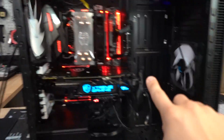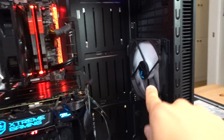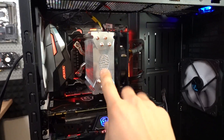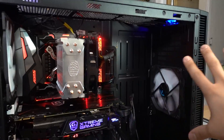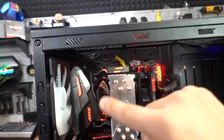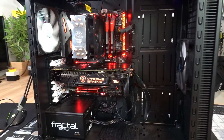The airflow in the case is probably fine — we've got a 140mm fan at the front and a 140 at the rear, but no fans at the top. If we go with an AIO, I'll probably mount the radiator to the front — that'll give us two or three fans there. Maybe we can relocate this fan to the top, or go with some RGB fans if I have any extras lying around.